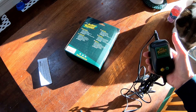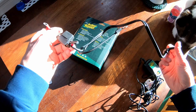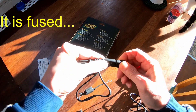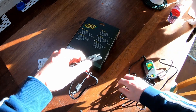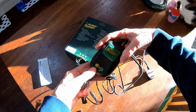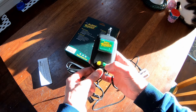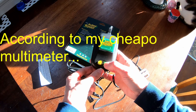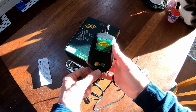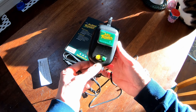The approach I'll be taking: it comes with a set of jump leads if you want, but I'll be taking the harness approach, where you fix the harness onto your battery and leave that permanently on the bike. When you want to tend to your battery, you pull off the cover, attach the other end, and just turn it on. It's very simple — if it's yellow, your battery is on charge; if it's green, your battery is being tended. I think it's about 14.5 volts when it's on yellow, and it drops to 13.2 just to keep the battery at peak capacity. You could leave it on all the time — I'm going to use it probably a couple of times a week just to keep it charged up. I know some people say they'll start their bike and run it for a bit, but that probably doesn't restore the battery given that you'll have drained quite a lot just in starting the engine.